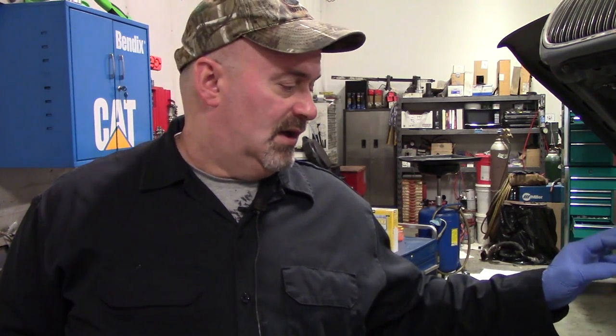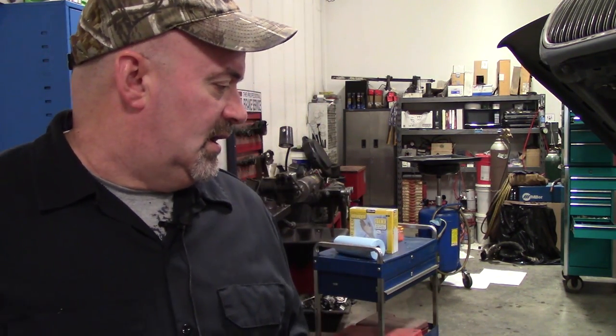Another talk with the customer. We're gonna plow forward with this. I'm just gonna do an oil change, an upper intake plenum, replace the manifold absolute pressure sensor that's blown up, and the pressure regulator, and get this thing back on the road and hope for the best.